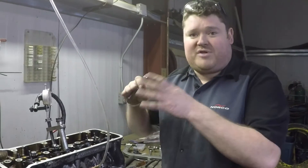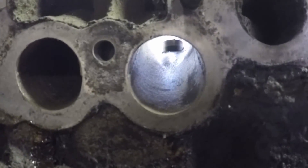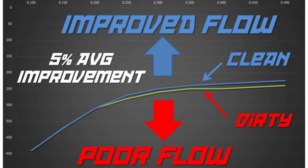That concludes our testing with the cylinder head — dirty as it was pulled from the engine, and clean after we've brushed off the valves and basically cleaned any carbon out of the inlet ports. The results were quite interesting — quite astounding actually. Carbon on the valves and a dirty chamber makes a hell of a difference. We noticed that at very low lift there wasn't really a lot of change. However, as soon as you hit about 250 thou of lift, everything changed dramatically — dirty versus clean. The 300 thou mark, which is really important, was a big change, but the top end especially was a relatively big change percentage-wise, even if it wasn't still optimal flow.